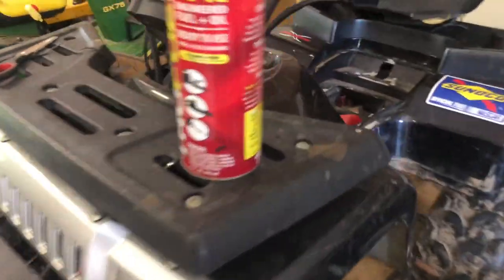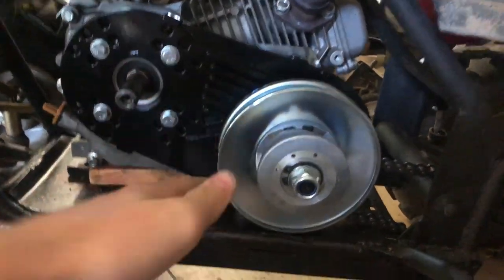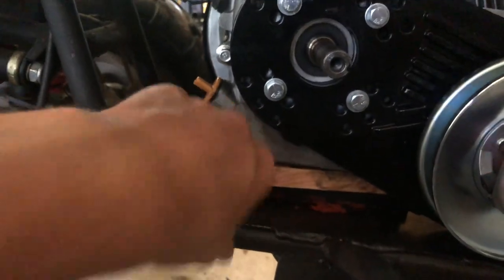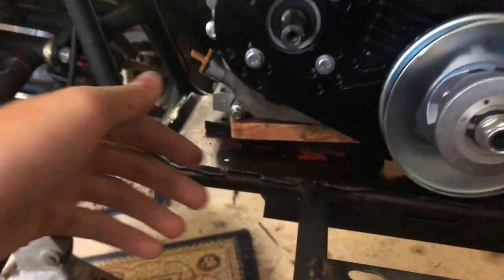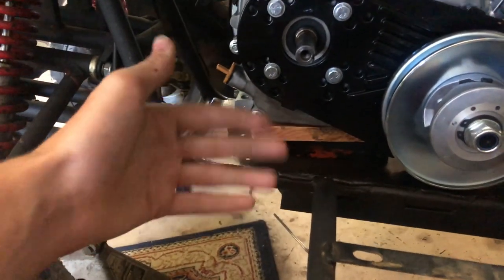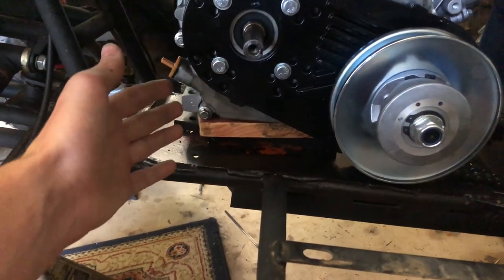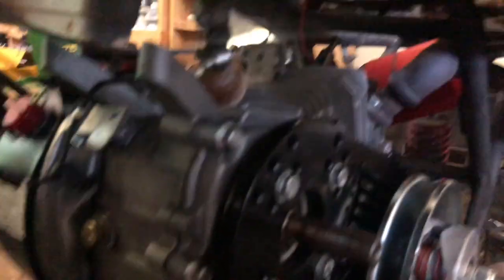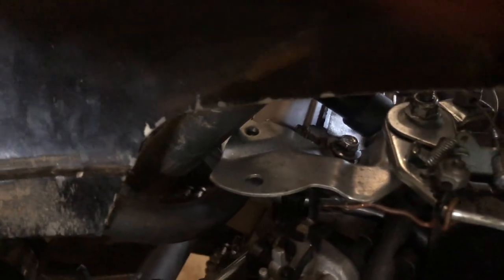It's another day. To raise the engine temporarily just to check if the mock-up will work, I got a one-by-four, cut it in half, and put it between the engine and the bottom plate to jack it up about an inch — which is exactly what a square-tube one-inch engine riser kit gives you. I'm probably going to get the engine riser kit. With the engine raised, the exhaust almost clears — still a little bit of room — though I might have to trim part of this small bracket.